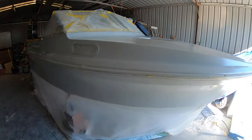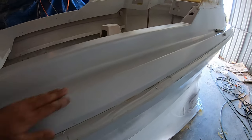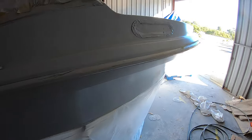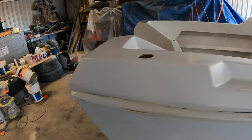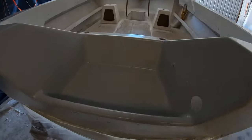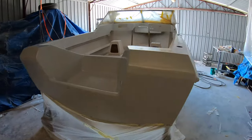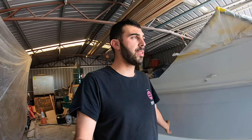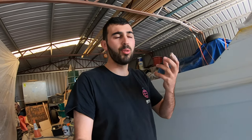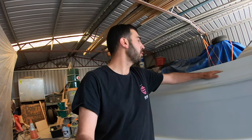Hey guys, it's the next day and we're back. Here's the boat - this is what she's looking like at the moment. It's got a really thick layer of epoxy primer and this is where we start all the repairs. What's good about this is you can actually see now all the little imperfections in the boat - where we've missed bog, where there's scratches, pinholes, all sorts of stuff. It just highlights everything which is good, and the epoxy primer helps everything to stick when we paint it. The plan today is to get the boat on the trailer which is pretty exciting. We're going to take the trailer outside and let the epoxy cook in the sun. It has been very cold in Perth lately, so we're going to do that today.